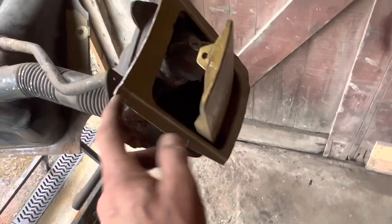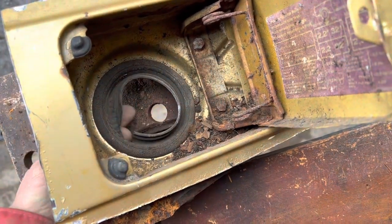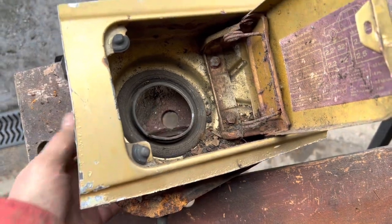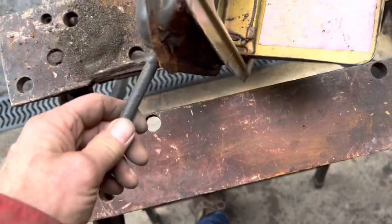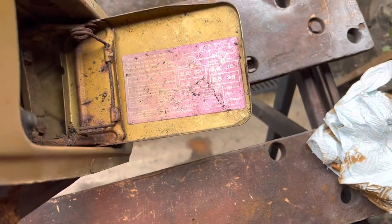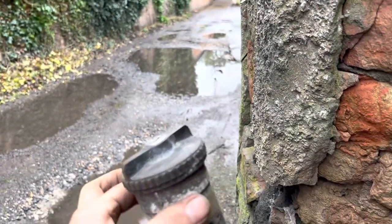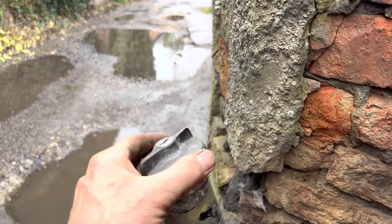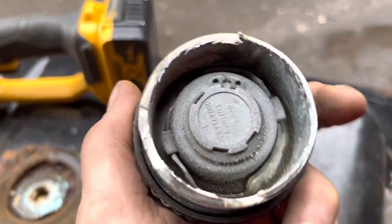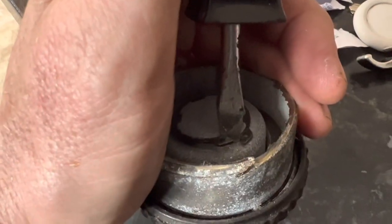Let's see if we can get all of this off and see what gaskets would be behind the filler. With the locked fuel cap, the filler just slipped straight through this gasket, and you can see this gasket is knackered — it's what keeps moisture out from the car — so we'll just be getting another one. It's also worth noting these two grommets here; we can probably use them for the project car, and possibly that sticker as well if we can get it off — although that might be for a 450 car, I'll have to check. I'm just going to cut the top of this tank off with an angle grinder and see if we can salvage this lock. That's what the back of that lock looks like — you need special circlip pliers that fit in those two holes, but in the absence of that you can wedge one screwdriver in one way and another screwdriver in the other way until that clip pings off.